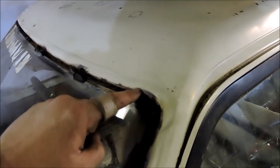And it also acts like a primer, so I'll spray it all around here. First I'll go around though with my air gun and blow out any debris, and then fill it with rust kill and let that dry for the next day or so, and then I'll go around with a little bit of bog and just fill in the holes, and then primer over that, and hopefully it sort of lasts, you know, a couple of years with a bit of luck.